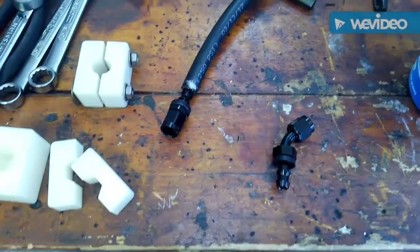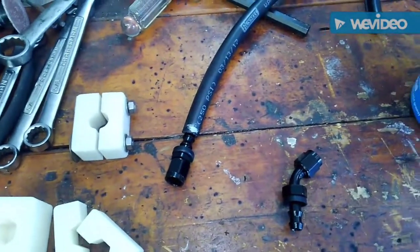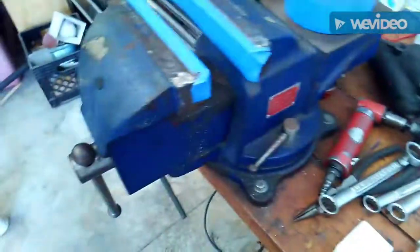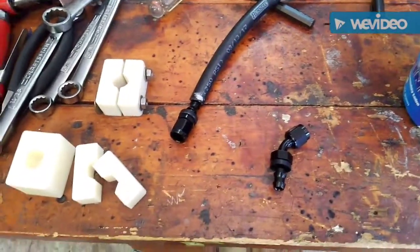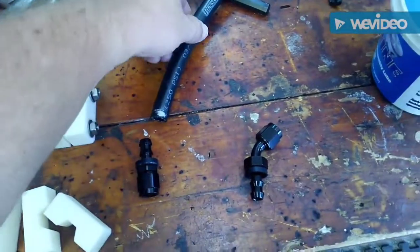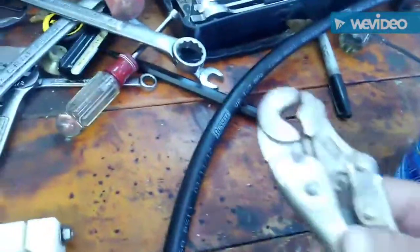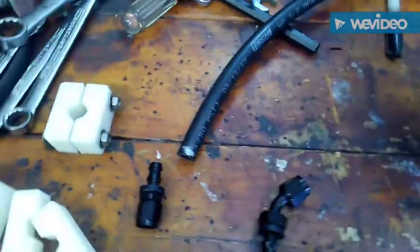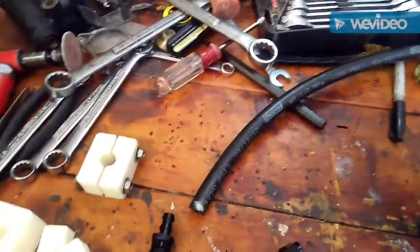I'm not going to spend $230. There's another pliers-looking thing Aeroquip sells — looks nice, not very expensive, 20 or 30 bucks — but it's plastic and they break. Doing them in the vise is one thing, but some of the fittings I have to do are on the Jeep itself. I tried using a small drill press vise to clamp the fitting with some vice-grip pliers on the hose to push it on, and I ended up using a couple of carpenter-type clamps to pull it together — actually worked pretty good. I thought there's got to be a better way.